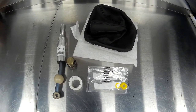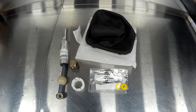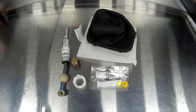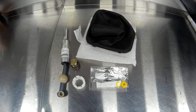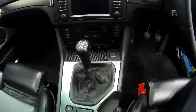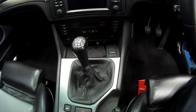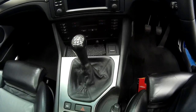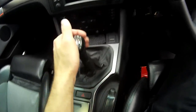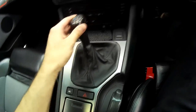Welcome to today's how-to guide. We're going to be looking at fitting a short shift gear lever and linkage kit using all BMW parts, and also replacing a couple of parts on the gearbox where the linkage system operates. You might be wondering why we're changing the gear shifter linkage mechanism. On the E39, the standard gear throw is quite long and cumbersome - going from first down into second, you can see that's quite a long throw.